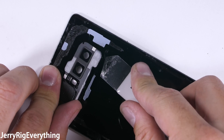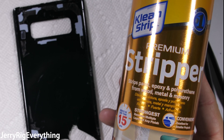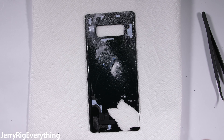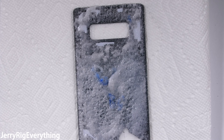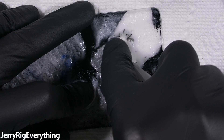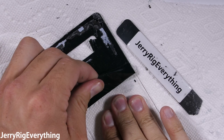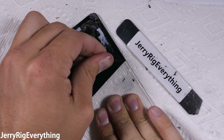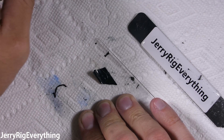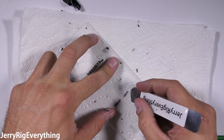I'll use some heat to remove the camera lens — it has a metal frame, so as long as I don't put any pressure on the glass part of the lens it will come off in one piece. This premium stripper will hopefully help soften the bond between the laminate layer and the glass. I'll spray the foam over the back panel and let it sit for about 15 minutes — chemically resistant gloves are really helpful here. You can tell the stripper started eating through my fingertips on my gloves, so I just rinsed it off and kept going. Once I got a large enough piece of the laminate lifted up it just peeled away entirely. But now if the glass breaks in the future it'll fall away in large chunks instead of being held together by that laminate. You win some and you lose some.